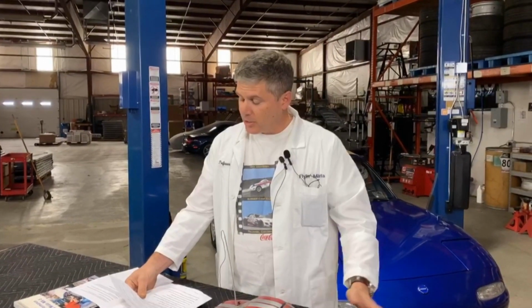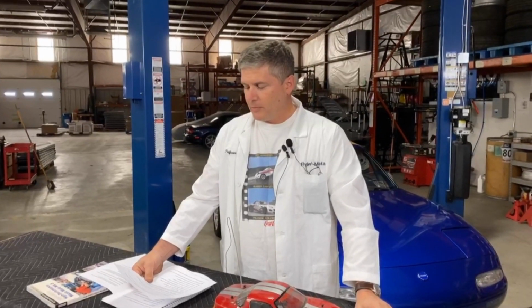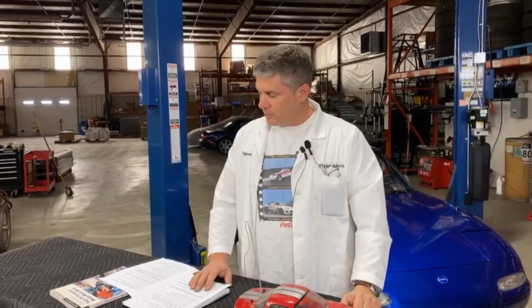Okay, what sort of benefits can a complete novice get from putting higher performance pads and discs on without new calipers? I think we've covered that. It's mostly about friction and heat behavior. How is the brake balance front to rear when you only upgrade the front brakes to 4-piston calipers? Again, that depends. Are you changing the diameter? Are you changing the sizing? Are you changing the pad compound? Difficult to say. Simply changing to 4-piston doesn't mean anything on its own, but chances are you're changing something else at the same time, whether it's pad size, rotor diameter, or piston size. So you will usually get more brake torque on that end, and you may have to do something to increase the rear bias, but that's a very broad generalization.